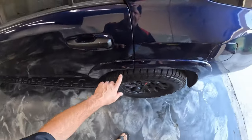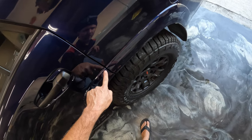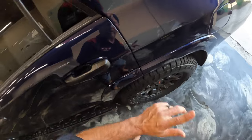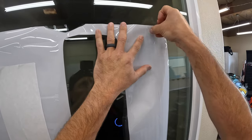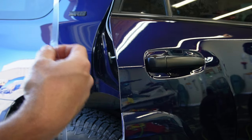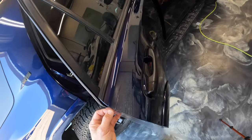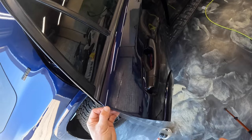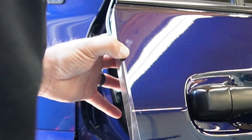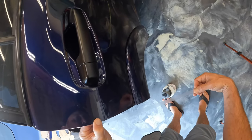We're also going to be matching a door edge. Looks like they start right here at the bend and then go down almost all the way to the fender flare — it's got a little bit of rounded edge here, then that one's just cut off straight. These door edge guards that we pre-cut out are about half inch wide. Basically what I'm doing here is installing it dry — that's the easiest and fastest way to get this done.